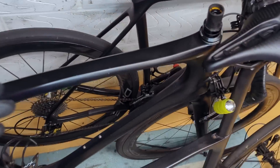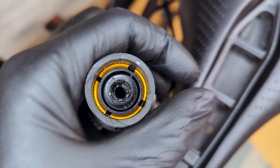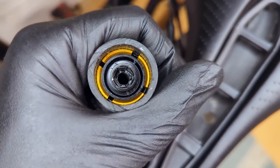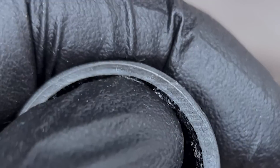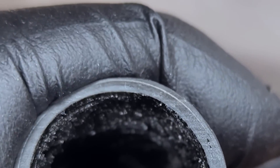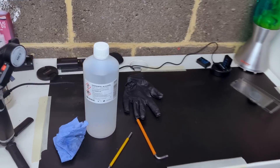This is my frame from eBay that I got in 2016, completely unbranded. While it's a bit of a rough cut on the top of the steerer tube, there's no sign of any glass fiber - very uniform color gradient there. This one from OG Evkin is the only one I'm slightly unsure about. You might be able to see a very slight difference in color on the edge there, so this is the only steerer tube of this bunch that might have a bit of glass fiber in there. Just to be sure, I also wiped down all of the tops with isopropyl alcohol to make sure I was looking at bare carbon and not just any grease.